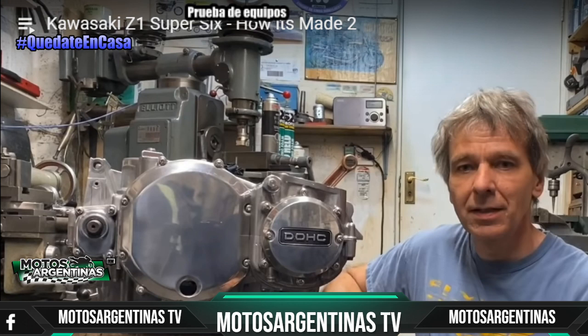Then, using a bit of ZX1 extra lube grease and a screwdriver, I put some grease between the 2 seals just to lubricate the shaft. With the sprocket cover assembled, it's time to fit it to the engine, carefully engaging the gear change shaft through the new seals and doing up the 4 screws tight.